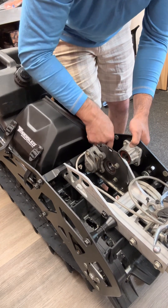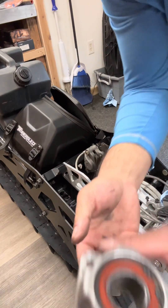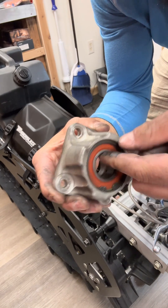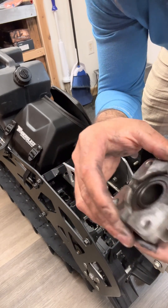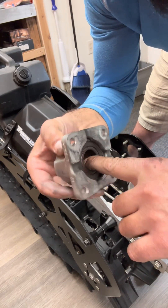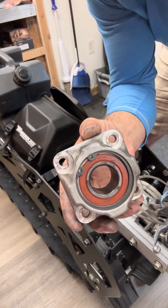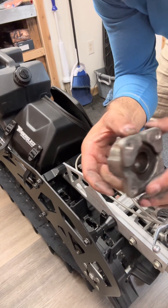They're built tough, easy to get parts, easy to work on. When you get in there and try to spin the bearings, if they get hung up at all — like right there that one kind of hung up and it's hard to move past that spot — same on the inside bearing. This one feels pretty notchy and done. Nice thing about these two is they're rebuildable, so you can get in there, get that circlip out, pack two new bearings in there, and have a freshie ready to go just in case you need it out in the field.